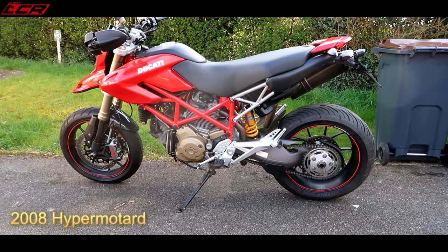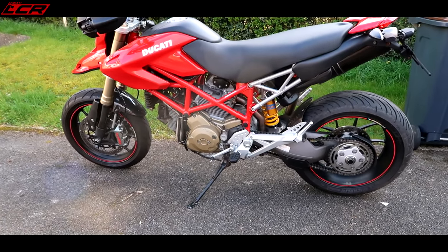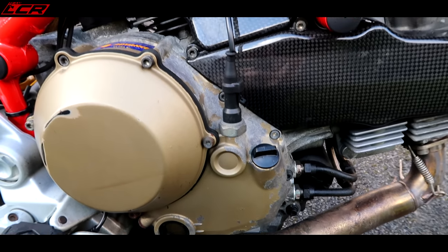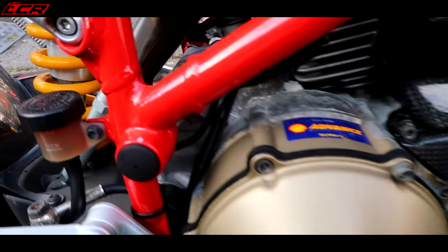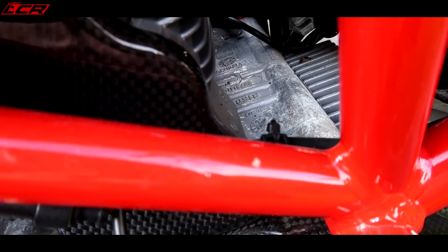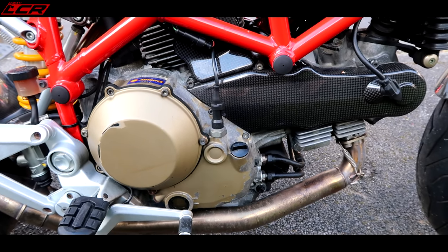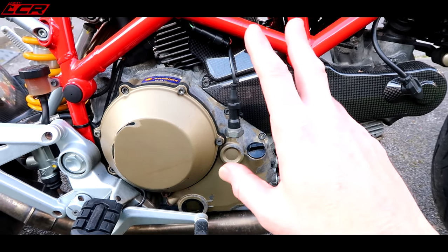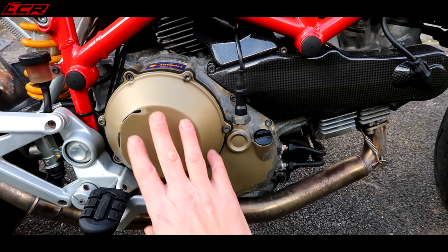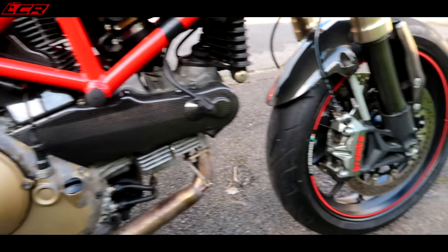There's not really a great deal wrong with it, in all honesty. The main thing, and the whole reason I want to do this job, is because of the engine paint. If you look closely, or even not so closely, there's quite a lot of paint flaking on the casings and especially on the actual engine. It's quite a common thing apparently with Ducatis of this age, and it really brings down the overall feel of the whole bike. So as part of this rebuild, we're going to take the engine out of the frame, repaint it, get these casings Cerakoted — that fancy coating — basically strip the whole bike down and go through everything.